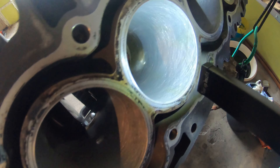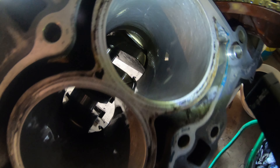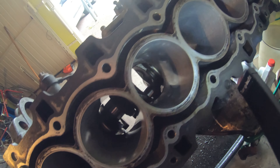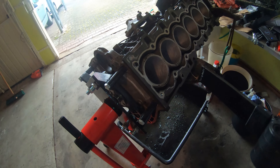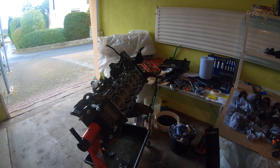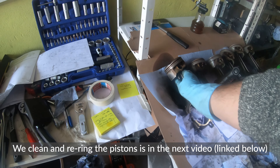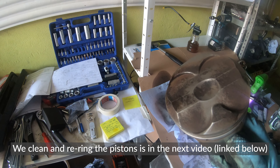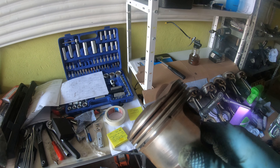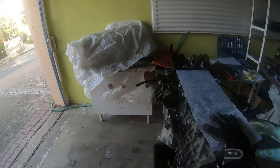We've cleaned up the engine block. Looks pretty good. There's still a little tiny bit of a lip at the very very top, but I'm okay with that. I've cleaned everything really well and doused it in WD-40, just to keep moisture off of the cylinder walls. I know that aluminum doesn't corrode, but just to make sure. That worked out really well. Now that all the pistons are clean, the grooves are clean, the holes are clean, everything looks pretty good. I'll go over these just one more time to make sure before I put the rings in.